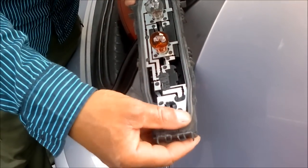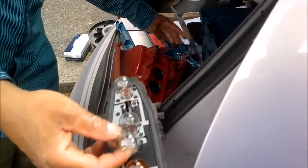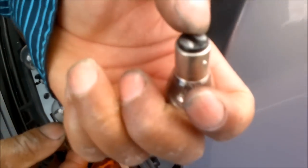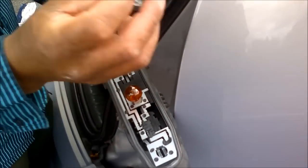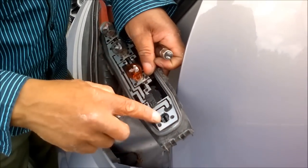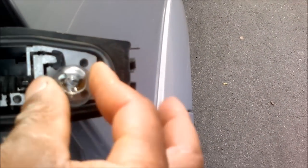That rubber back is just to stop water getting in your lights. Once you've got that out, you need to replace your bulb. Check the bulb you take out — you can see the burn on it. It's got two filaments in it and at the bottom two connector points. Here's our new one. You'll notice on your bulb one pin is higher than the other. Locate it in the groove, press it down, and if it won't go turn it around the other way, press it down and twist — and that's it.